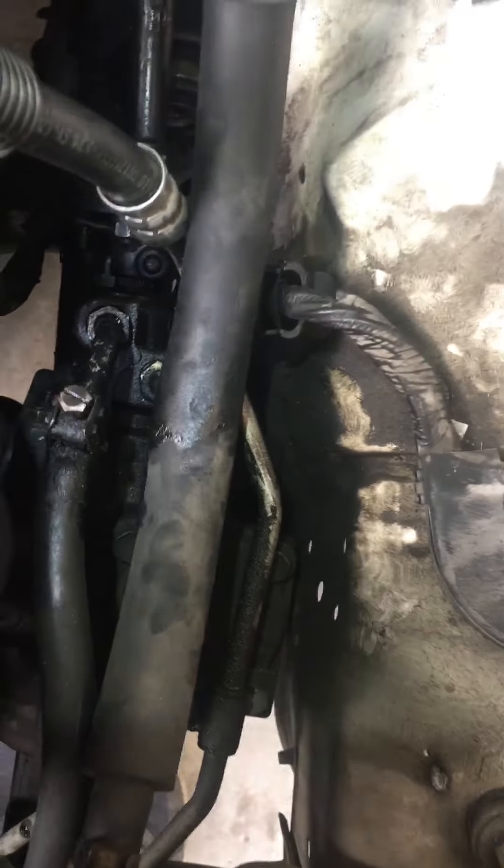I actually had to loosen this line and some other little components. You can then see the steering shaft or steering column move out of the way so you can remove the upper control arm — otherwise I have no idea how else I would remove it. I needed a new bushing, that's the reason I did it. It wiggles out of here — there's not much room because the control arm hits this. You don't need to remove the shock; it wiggles out through here. One hand should go on the power steering pump and just press up, and that column moves enough to wiggle the control arm out.